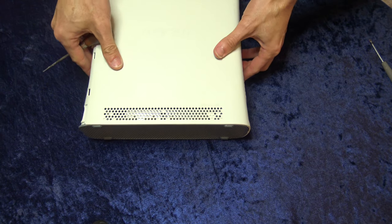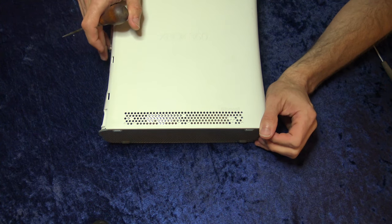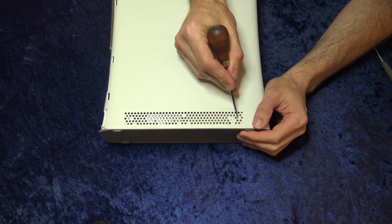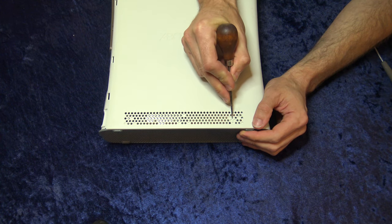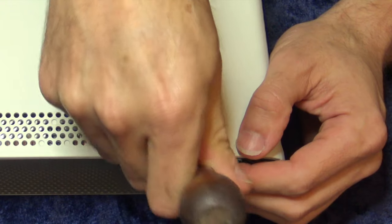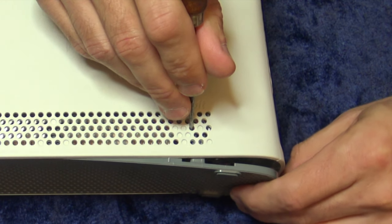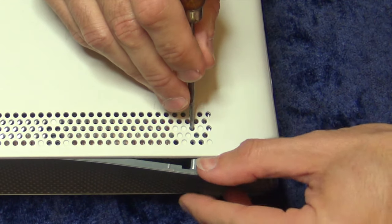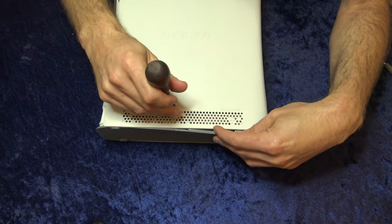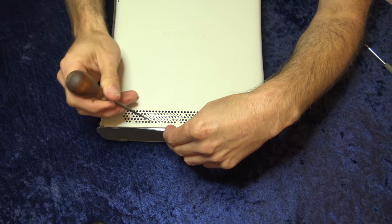Rotate the Xbox 360 either onto the top or the bottom. You'll need to remove the two grey grills that are on the sides. To do that, take a push tool — in this case an awl or a very sharp small push tool — and push some grey tabs through these holes to release the grey grills. Some of the grill holes are filled in white; look around or between them to find the push points for the grey tabs. Push gently because you can break them, especially if your Xbox has been exposed to heat like this one was — stored in a garage for seven years.